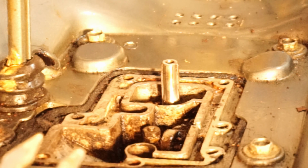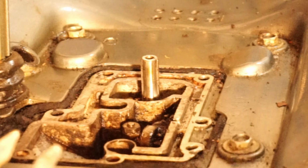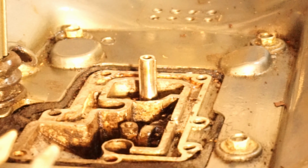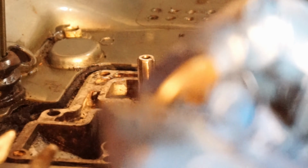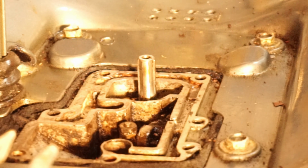So when I do the seals on this, you can buy the whole kit online. But I just replaced the O-ring in the carbon fiber. And the black carbon fiber piece that comes up to the top, there's an O-ring in there. I replaced that, and then I replaced the seal on top, the bearing top seal carrier. So, cap to hold the spring.